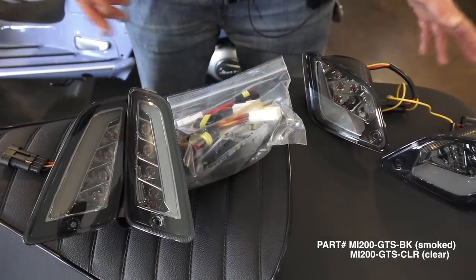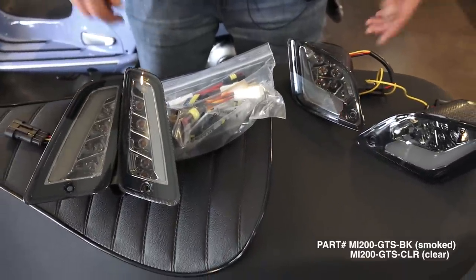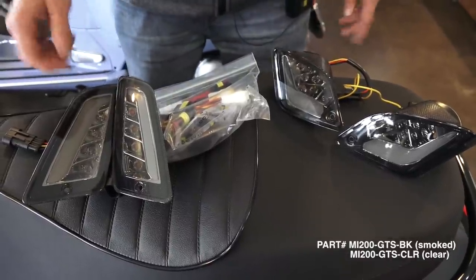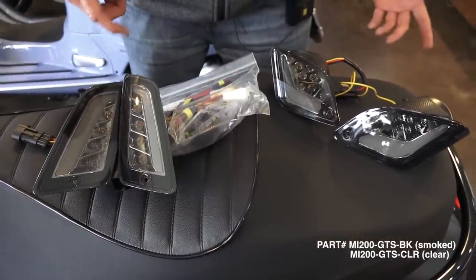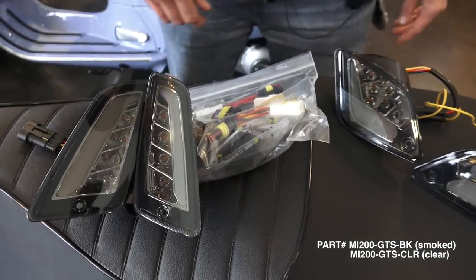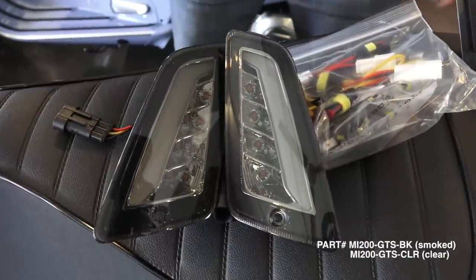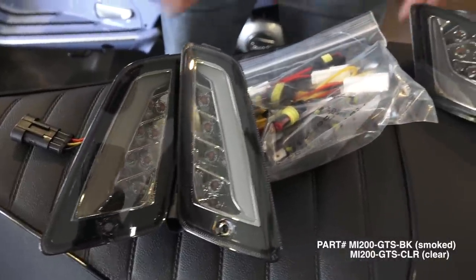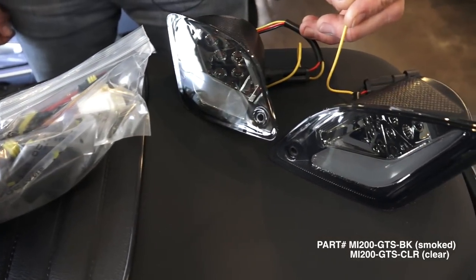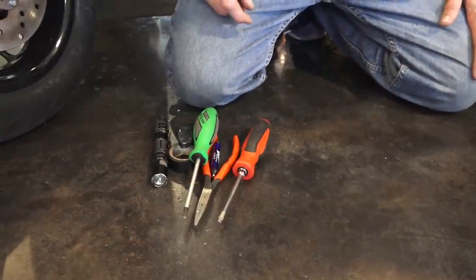If you have a 2020 Vespa GTS for the US market, they should have all the correct plugs because they've finally gone over to the European style turn signals with LEDs. From what I understand, this is 2019, I haven't seen the bike. If that's the case, all you need to do is put the flasher in place along with the four sets of signals that are plug and play, minus the rear, with an extra power wire that I'll show how to hook up.